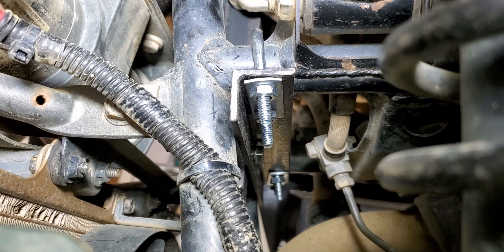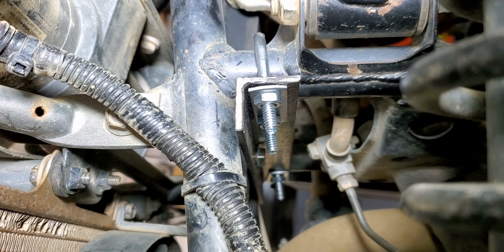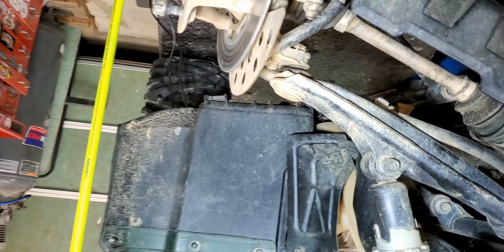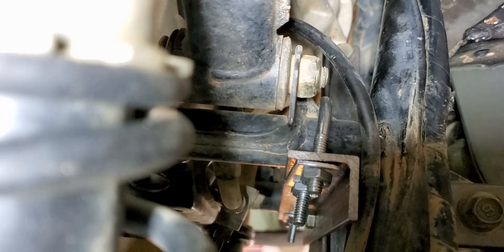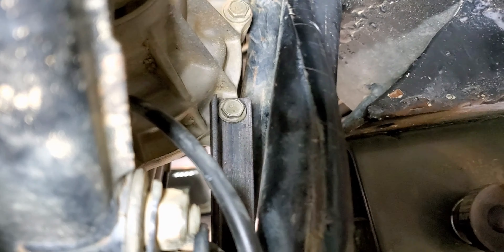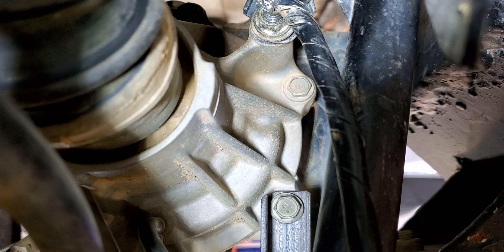This is going to be tough to see — I made a bracket for my front differential. You can see the bar coming down, attached to the top of the frame. I used angle iron because I think it's a lot more rigid than flat iron. That's about a 10-inch piece going all the way across with four holes drilled into it so I can put U-clamps on there. There's also a bolt in the center, and you can see where the angle iron goes down to the differential itself. Like the Turner Cycles design, it's going to allow me to have an upper support on the front diff to keep it from twisting and burning up the brackets.